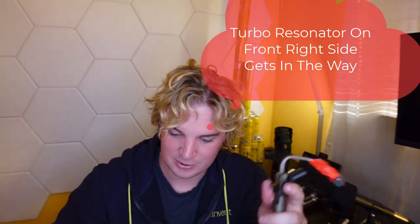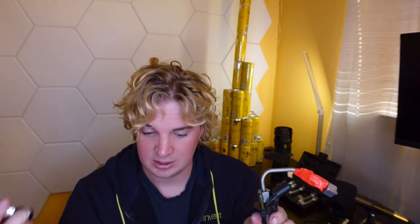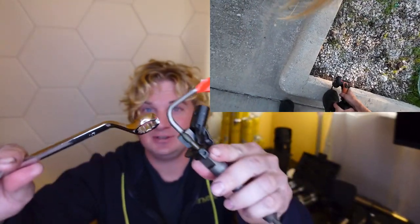There's a better, cheaper solution — you get to make your own. This is a regular 12-point from Walmart, this is a regular 12-point from somewhere else. This one has a little bit of a dip in it, which makes it a bit easier for certain injectors. This is the perfect tool. All you've got to do is take your hacksaw or angle grinder or whatever you use and cut a little piece out to fit over the line.